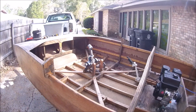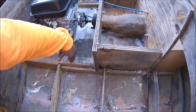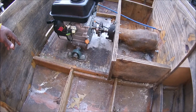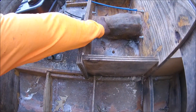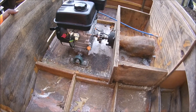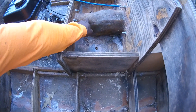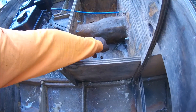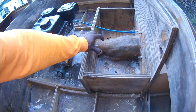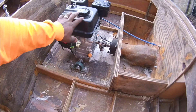Finally done with all of the touch-ups listed from the previous float test. One extreme to the other — I went from a three-to-one ratio to a one-to-one-point-eight. As far as on paper, the pump shaft is spinning five times faster than last time. That's not going to increase my speed by five because you have to take into account water resistance. A couple guys also informed me about cavitation, which is caused by this big void hole — I have an intake right here where the shaft comes in, and there's about a two-to-three-inch hole around the shaft. I need to make that hole smaller to prevent cavitation, which causes drag.